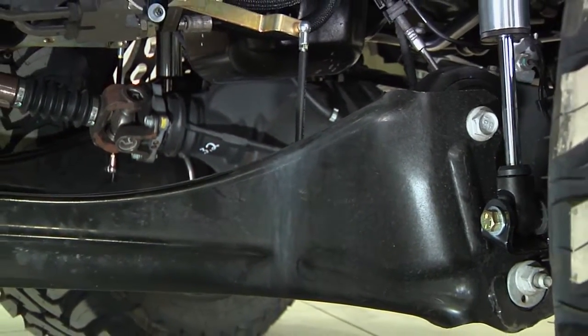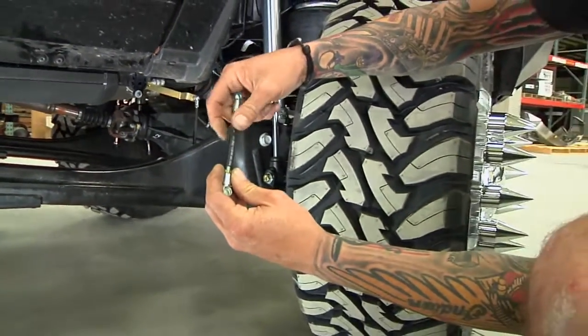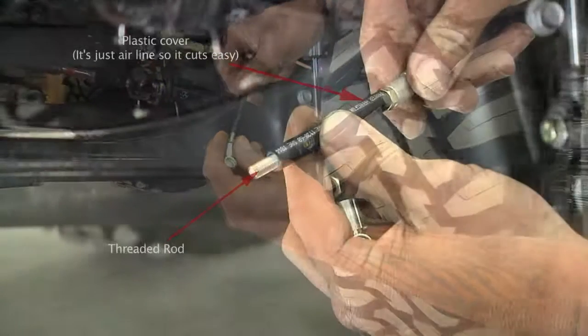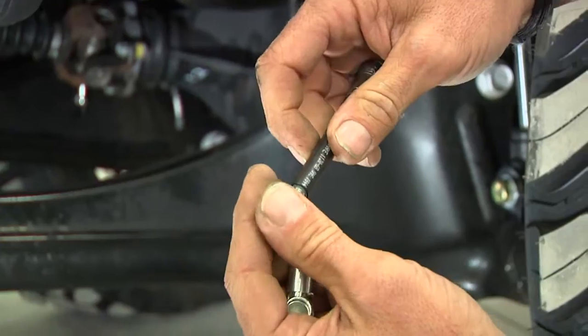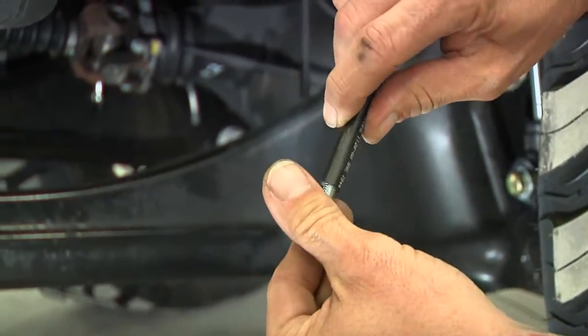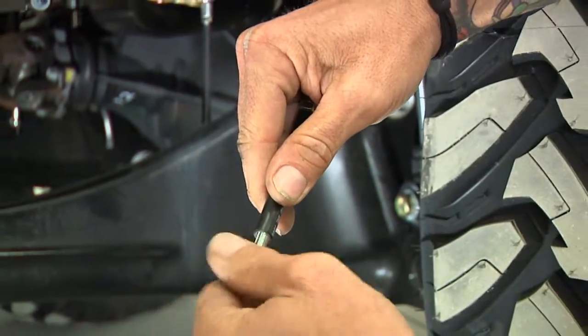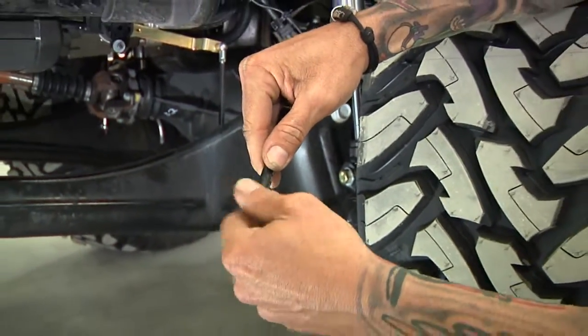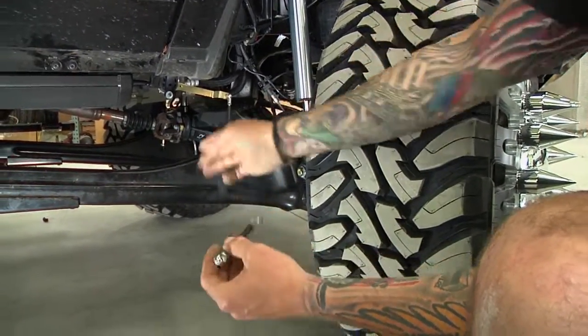We have adjusted the linkage — they're real easy to do. If we send the linkage, it's typically going to be a little bit long. You simply unscrew it, cut it off with a sawzall or chop saw. This is just air line covering it up so that you don't see the threads. You put it back together. What we want to do is make sure at ride height, before we go setting all of our programming points, that the sensor is straight up and down.